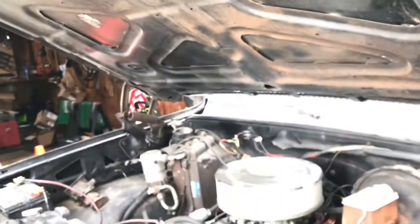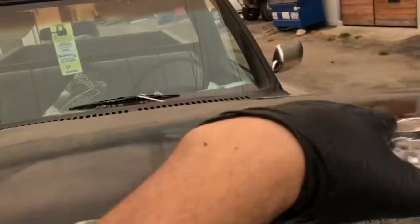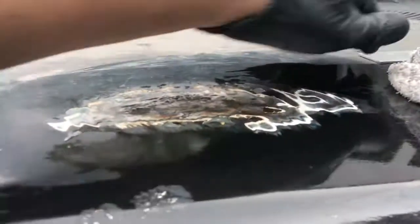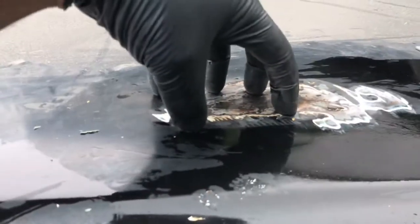But underneath, yeah, it's tough to get in there. I'm able to get in there and beat up some of that. So I think the hood is straight enough to keep. I think I'm going to try that now. I'm going to try and heat that and heat that. Let's see what I can do. Canning issues is you often move the issue around. I heated that area. I still definitely tightened up this area.